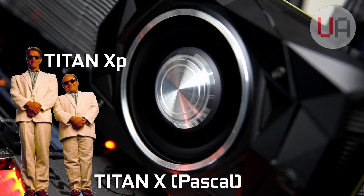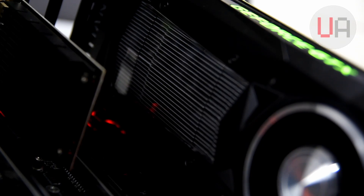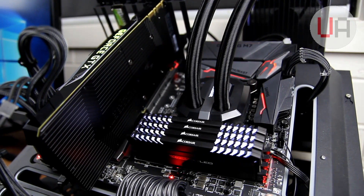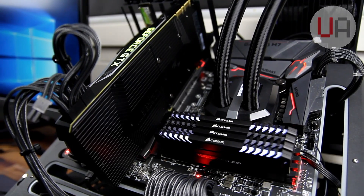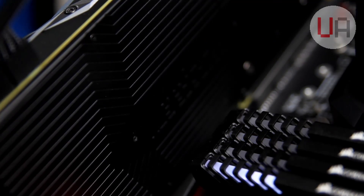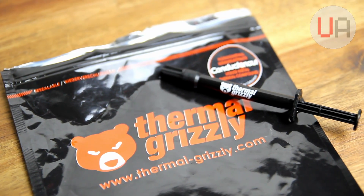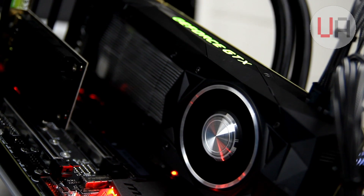This is the Titan X Pascal, not the new Titan XP. Why do we want to do this? Basically because the thermal throttling on Titan Xs is a big issue because of their blower-style reference cooler design. I want to see if doing this will help reduce temperatures and make using the original cooler an actual viable option. I'm going to be using the Thermal Grizzly Conductonaut, which is a liquid metal paste. Let's run some tests to get our baseline and see where our starting point is as far as temperatures go.